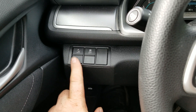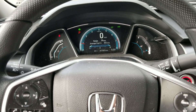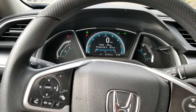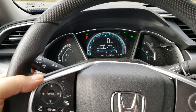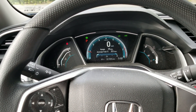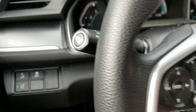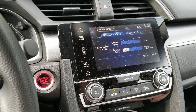This is lane mitigation — if you leave the roadway it'll stop the car. I had an unfortunate incident where I made a right-hand turn onto a gravel driveway and it stopped and wouldn't let me go, because I didn't use my blinker. If you turn the blinker on to make a right or left turn, you can leave the roadway and it doesn't do anything. Also when you put the right-hand blinker on, the blind-spot camera shows up so you can see next to you. You can also activate it with a button on the end of the stalk.